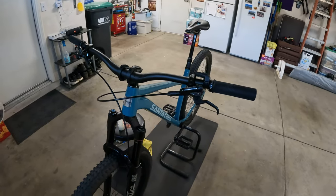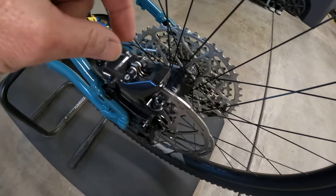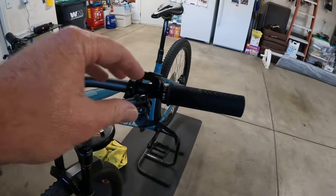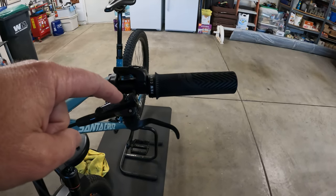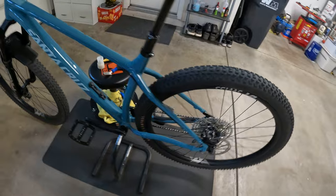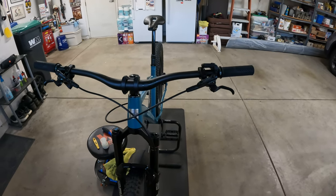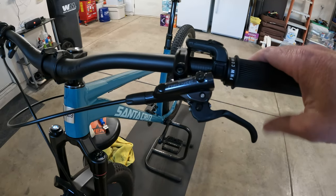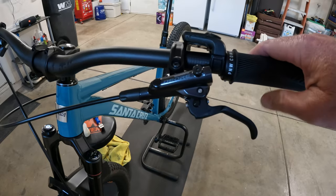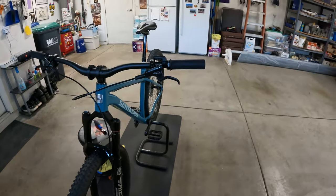So when I read online about people tearing the brake diaphragm, I thought it was because they overfilled the system. Shimano's official stance on fluid volume is simple: they want the pistons all the way back into their bores, the yellow thick bleed block installed, then bleed the system to get all air out, put the funnel in, then remove the funnel and seal the system closed. Then remove the pad spacer, put in the new pads, install the caliper on the bike, put the wheels in, and use the lever to set the proper fluid level. The first two or three pulls after doing this will go all the way to the bar as the pistons squeeze together — that is Shimano's official stance on fluid volume.